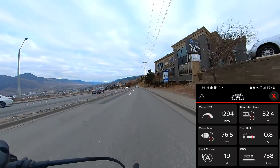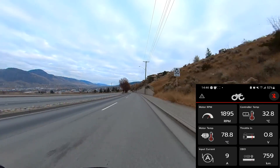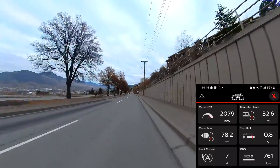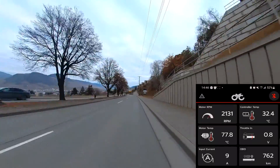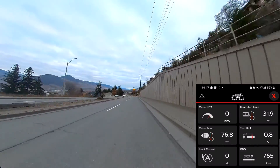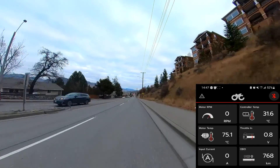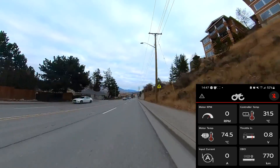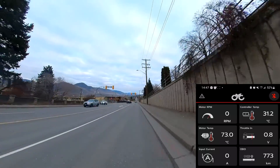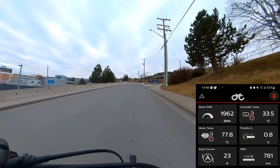I'm sure CYC will release a gen 2 of this motor, but unless they change the actual type of motor being used I don't really see how they can improve the way the motor sheds heat. If they do a larger Photon, unless they make it an inrunner, won't it just have the same issues except they'll be forced to say it's a three kilowatt motor just because it's bigger? If this were an inrunner they could work on heat sinking, improve it, change the pattern, add more — but they can't really increase the contact area for heat transfer with an outrunner. They can't get rid of the casing because it would expose it to being destroyed pretty fast by bumps and knocks, so it's always going to be trapped inside this cocoon struggling to shed heat effectively.